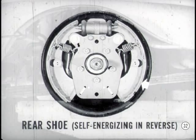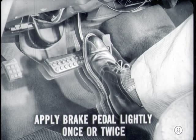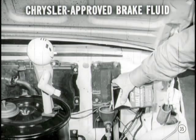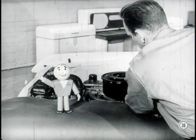Now, here's a tip: before you let the car down on its wheels, apply the brake pedal lightly once or twice to test the action and to get the shoes properly centered. Then rotate each wheel to be sure there's just a slight drag. If necessary, go through the adjustment again to be sure it's right. Finally, examine the fluid level again and install additional fluid if necessary. Remember, use only Chrysler-approved brake fluid. If you technicians follow Bert's instructions to the letter, you won't run into any more spongy pedal conditions when you bleed and adjust brakes.